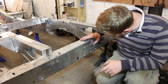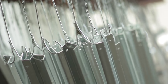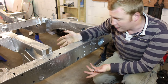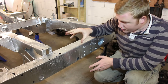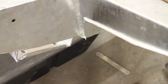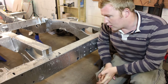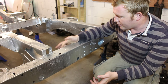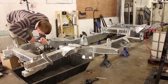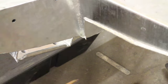The first step is examining the galv itself. When you hot-dip galvanise a chassis it's quite difficult to avoid getting imperfections and little spikes of zinc material. Richard Chassis very kindly ream out all the holes so you don't have to do that yourself, but there are still some spikes and imperfections that could show through the top coats — so I'm just going to go around and gently file these off. Only lightly file spikes and be careful not to file straight through the zinc coating.